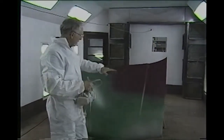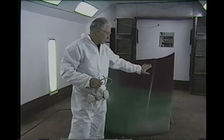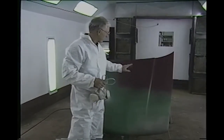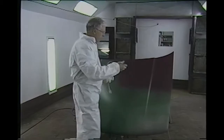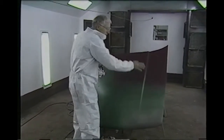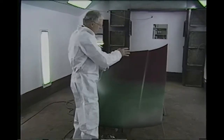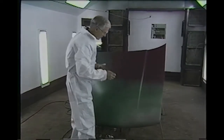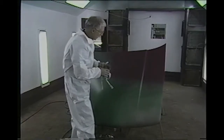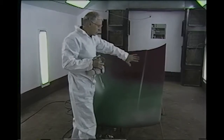Now what I've done here is I put my color coat on to get coverage over the spot I wanted to paint. And then, as you can see, I took the gun and sort of took it in the opposite direction, and I fogged a thin coat on it — sort of flowed it together. That way you can get rid of these dark lines. You have to flow it together after you put your color coat on.